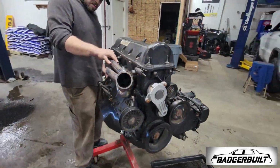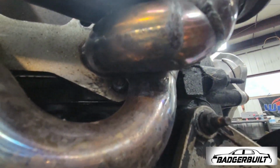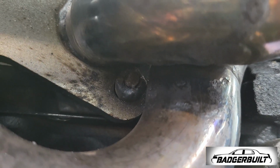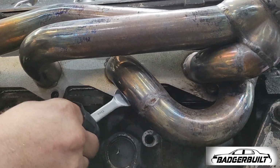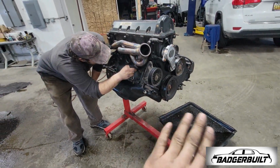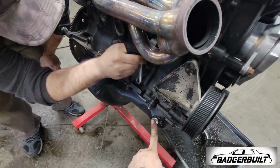The heart of the beast is out, and we're here to deal with that horrible, ugly nightmare. And that's why I figured we'd pull it out. We checked for crankshaft end play, there is none. So oil pan staying on. We need to cover this.